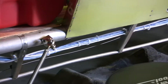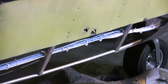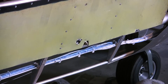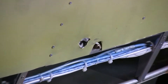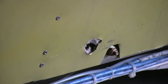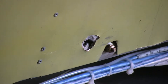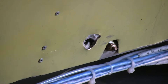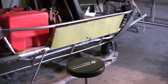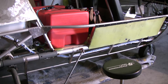Going forward on the longeron, I have some aluminum on the side there which is going to be covered up by fabric, but that's forming a backdrop for some storage compartments I've put up inside the cockpit. Forward of that is a hole — this was scrap aluminum, it's very thin and tears easily — and behind that there is a hole in the longeron where the forward lift strut will attach to the side of the fuselage. So those are the two points where the lift strut brackets will attach.